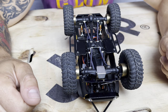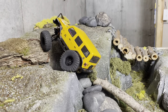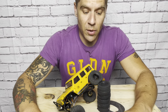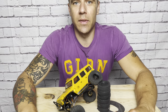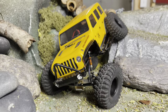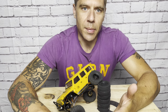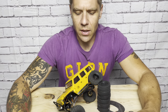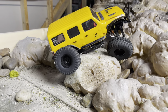As you can see, not a whole lot done to this from a drivetrain perspective. I went at it with the same approach I do with most of my rigs: widening out the wheelbase, putting a lot of weight in the front, getting those wide wheels and tires, the double barrel suspension set up properly. And when all that came together with the JLU, right away the thing was totally transformed and was a rock star right out of the gate.